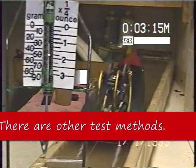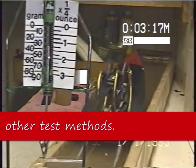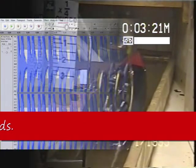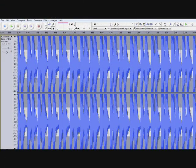To measure hertz using video, I play it back one frame at a time and simply count the number of pulses per second. Another way is to record the sound and play it back on a program where you can see the waveform displayed with a timeline, or use an oscilloscope. You will need to divide by two, as the engine makes a sound on both strokes.